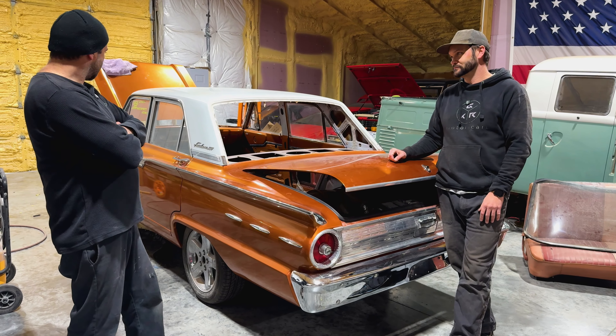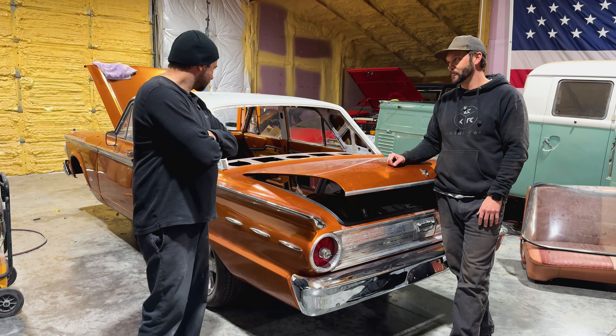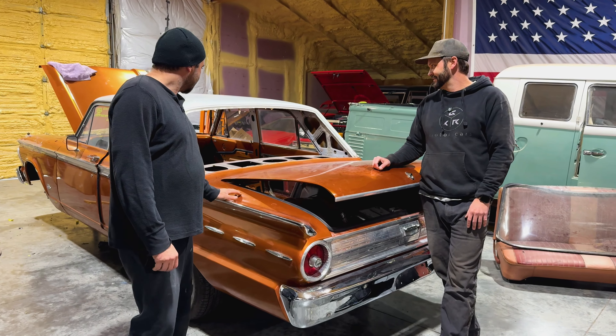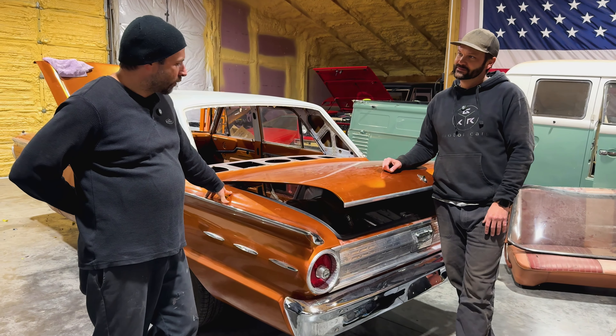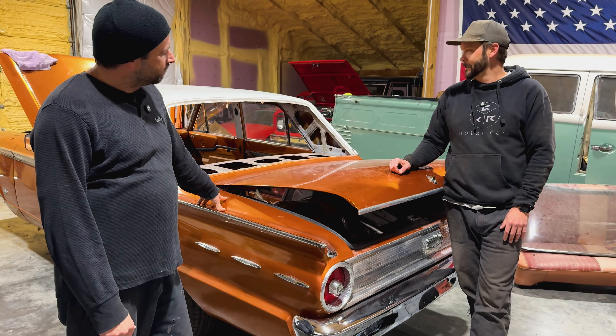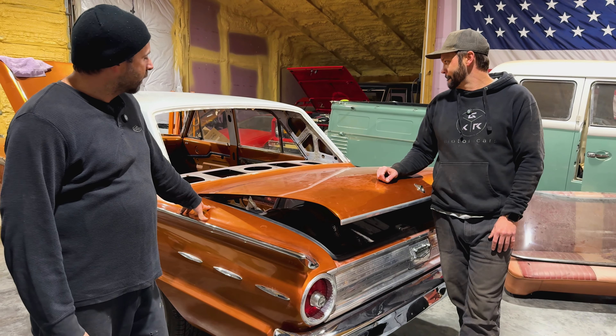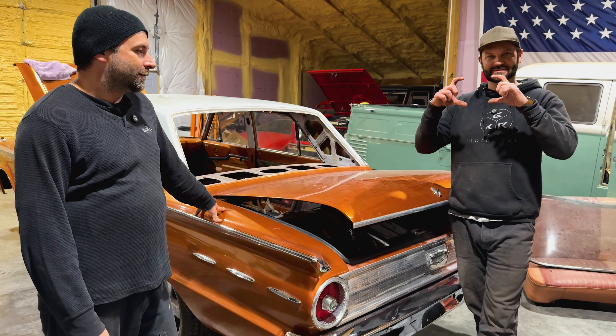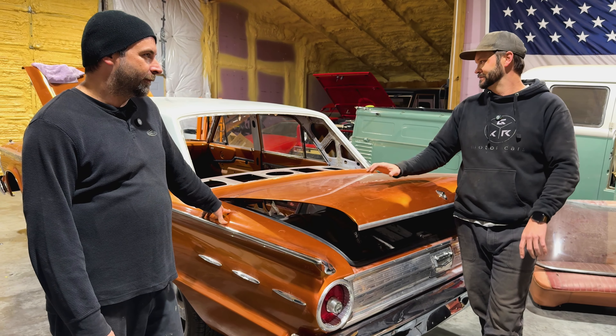How's it going so far? Not too bad. It's a little different from the Camaro — the harness isn't as nice as the Painless harness the Camaro had. No connectors or anything like that, so I've got to go put all new connectors on it. And I don't know anything about a 62 Fairlane, so I'm kind of just figuring out what goes where. We have this big old manual — it's like this big. We'll figure it out. It's the Fairlane Bible.